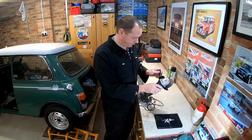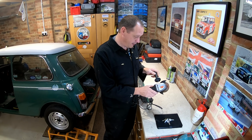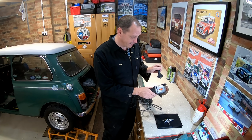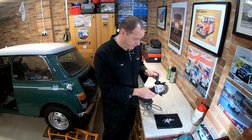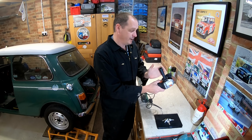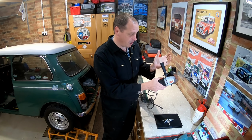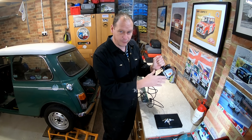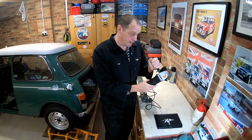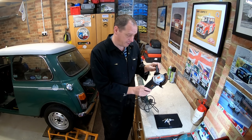So generally these get taken off because you wanna get into a tight area or something like that. And there's a big element of complacency here, so I'd have taken that off long ago, not refitted it. If I had had that secondary grip while using the angle grinder, it would have still kicked, but I would have had the grip to be able to keep control of the angle grinder. Once it gets out of control, it gets quite dangerous.